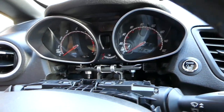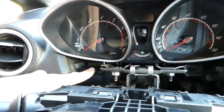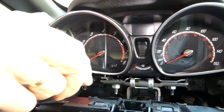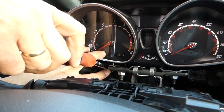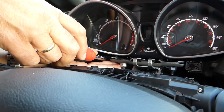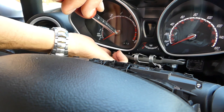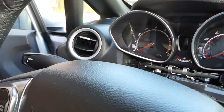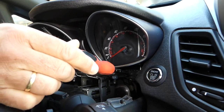For the cluster, we have two screws — one here and one over there — and they are Torx 20. All the tools we use will be in the description of the video. It's very important not to drop a screw into the steering column. I've dropped one before and it took quite a bit of time to find. This is what the screw looks like and that's how long it is. Same thing on the other side.